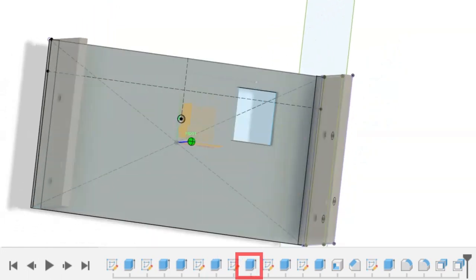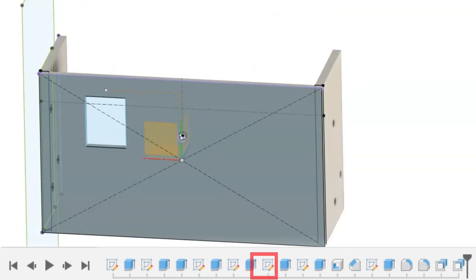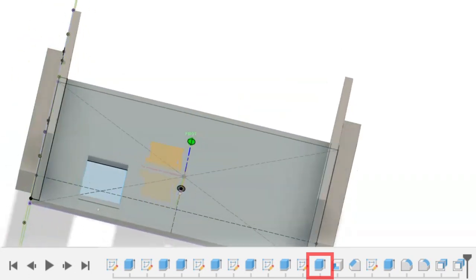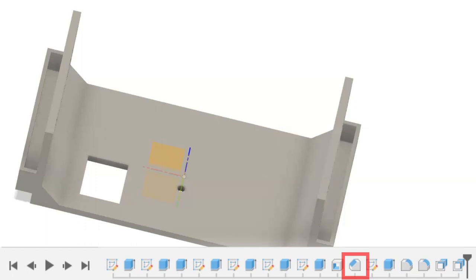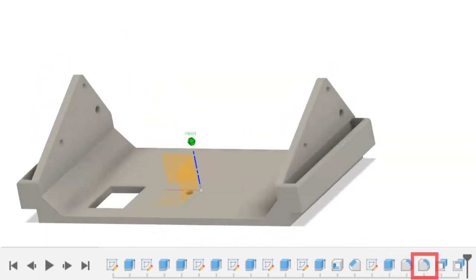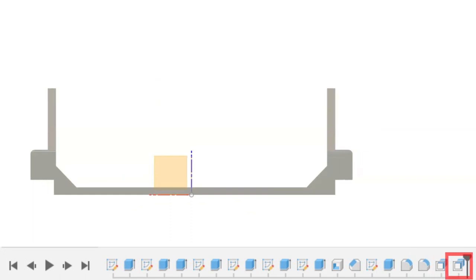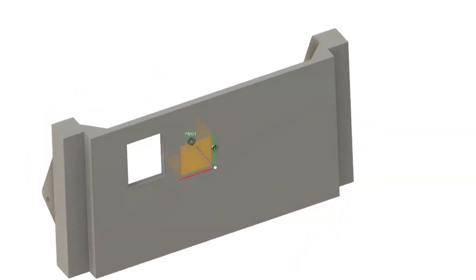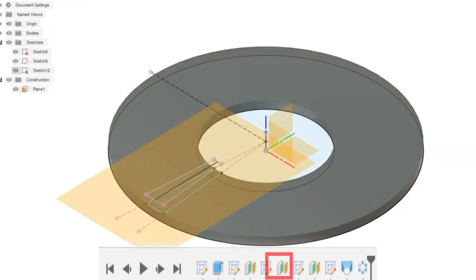What I'm showing you now is how I designed it in Fusion 360. I'm pretty sure this works for all models of Jeep Wranglers from 2007 to 2018 that have a double-din radio. This was the third round of creating this and actually making the measurements correct. I printed two prototypes and they didn't quite fit. Then I realized I made some measurement issues.